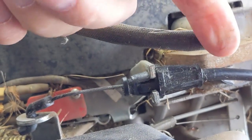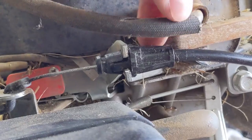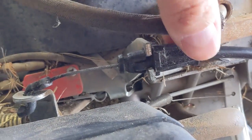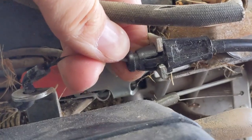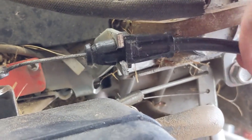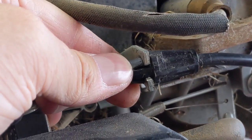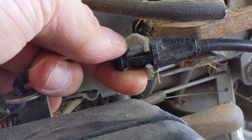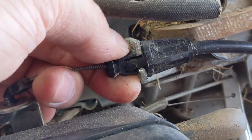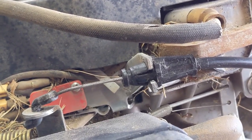The way they work is you simply hook up your Z-bend right up here, then you pull the conduit back, put the cable through the slot, and just pop the plastic into the slot on the metal bracket — it holds itself into position. However, to remove these can be a little bit tricky because you have to push down and squeeze on these plastic tabs in order to pop that cable conduit out of that metal bracket.